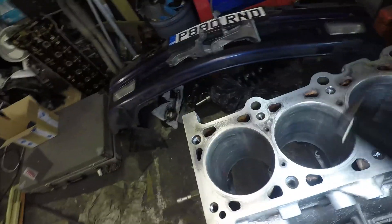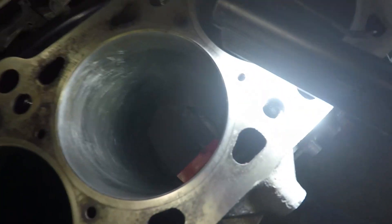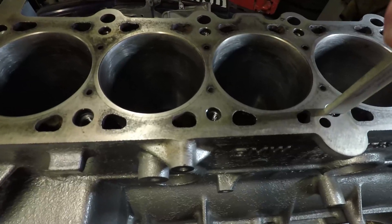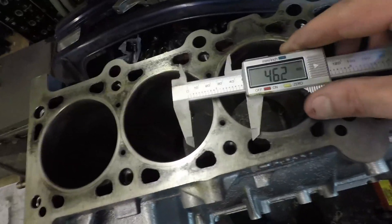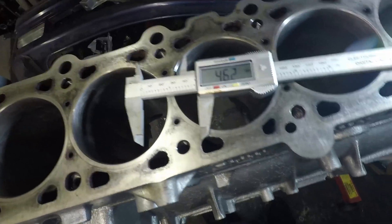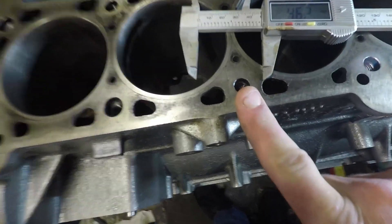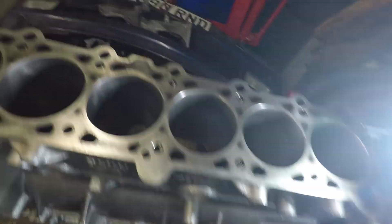I want to show you a couple of things if you're swapping from an M52 block to an M50 like I have. Looking at the block, the first thing I've noticed is the threads in the cylinder head holes are dramatically smaller than they are in the M52. The thread depth on the M50 is 30.7mm; on the M52 it's 46.2mm. My initial thought was I'm going to need different cylinder head bolts, but they're the same part number and therefore the same length - so the M52 holes are just deeper. Interesting to note but doesn't cause any grief.